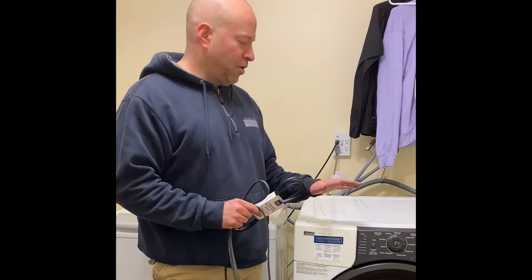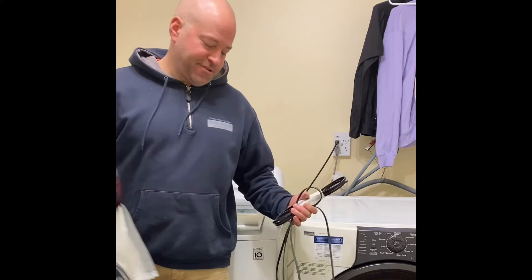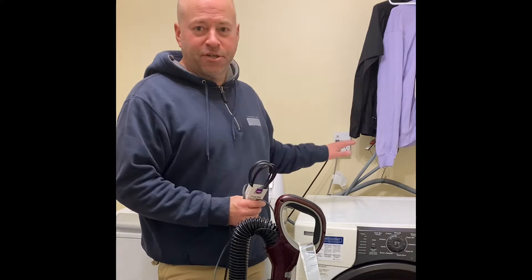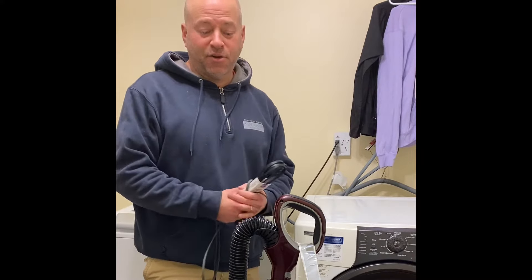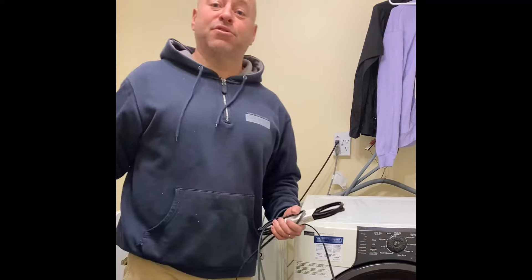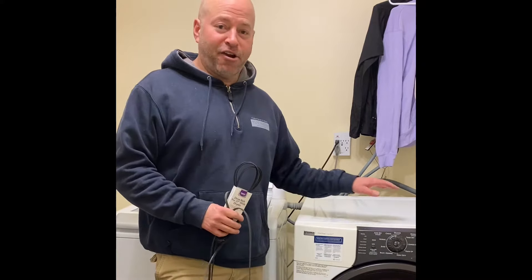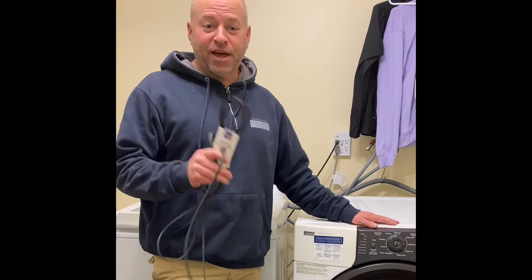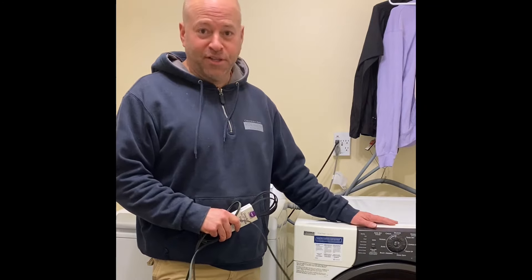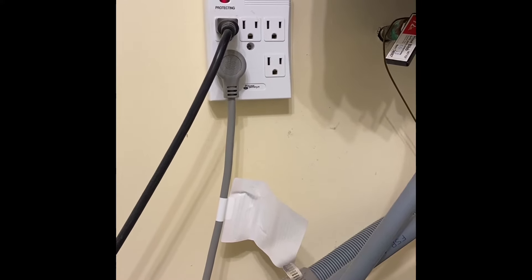While you're doing this, take advantage of the opportunity — get your vacuum and do a really good job getting all the lint out of your dryer system. That's a big fire risk and one of the top ways people have house fires. So use this opportunity to clean up while you have the dryer open.